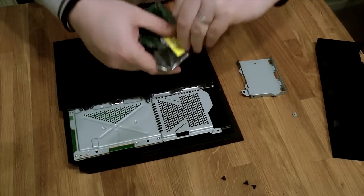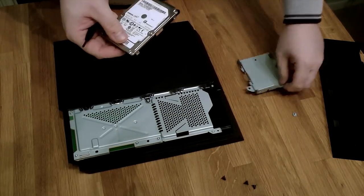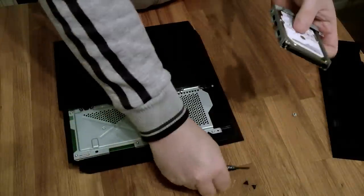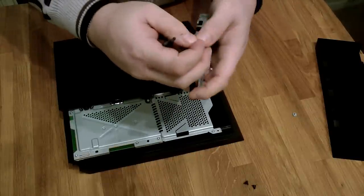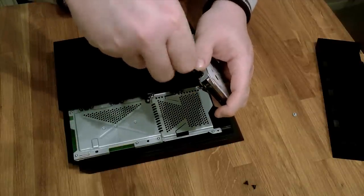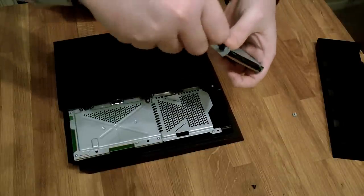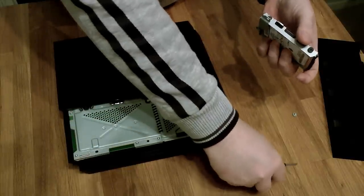Now get your brand new hard disk and get rid of that static casing. It goes in label-side up, with the connections facing the open edge of the caddy. Put the screws back in — they should all line up easily enough. It's a good idea to put them in loosely to begin with, then go around and tighten all four, so the hard disk is nicely centered and you're not tightening one corner so much that it twists it out of shape.